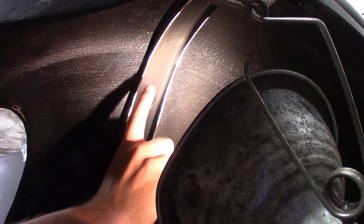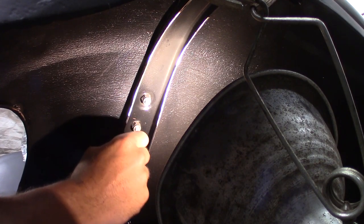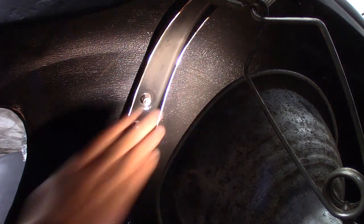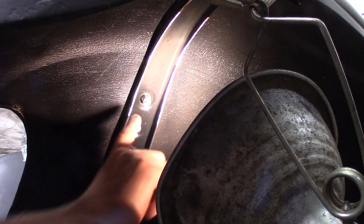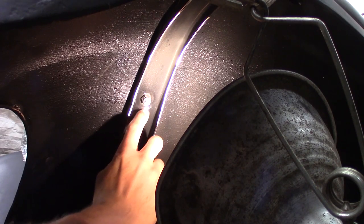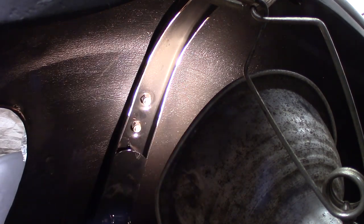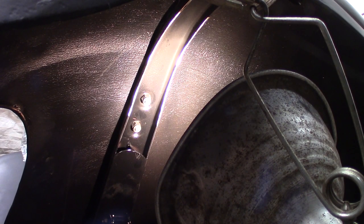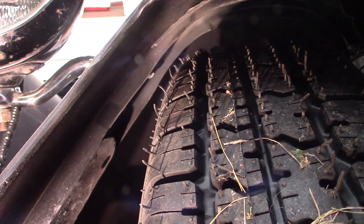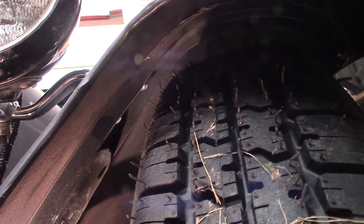Here's where the tire is hitting in the fender brace. I went and took it down — the brace is almost three-quarters of an inch thick and I took it down probably half the distance. I don't want to make it too thin because this brace keeps the outside of the fender from flapping around, but it's still full strength at the headlight bar mount and the shock mount. I've got about an inch and a half to the fender brace now where it was about a quarter inch before.